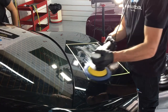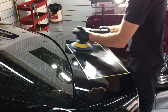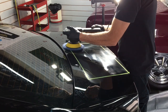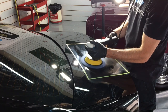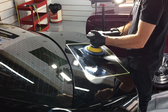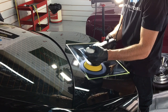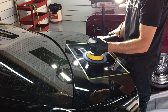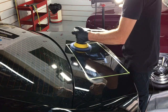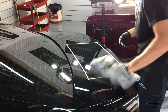We're going to find out the benefits and also the disadvantages of a second pass and spending all that time in one little area on the test area. It will get rid of a ton of imperfections. However, there will be a lot of stress with heat and there will be some swelling — I'm going to show you that with a paint depth gauge. There's a trade-off you want to think about: do you really want to chase after those last few scratches? I wouldn't unless the customer really wants you to. If you don't have the experience, grab those panels from the junkyard or body shop, set them up, and get experience that way — experimenting, burning through a clear coat, getting that over with, then practicing different levels of correction with different pads, compounds, and polishes.